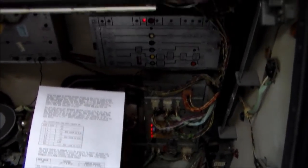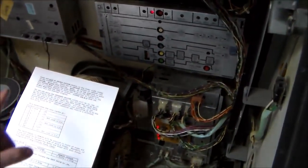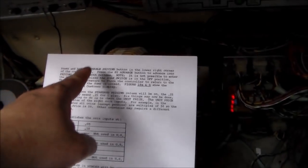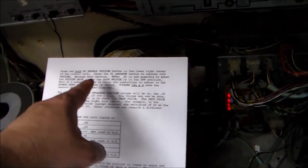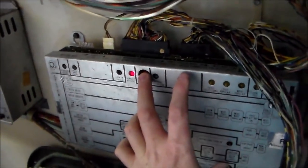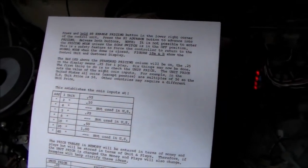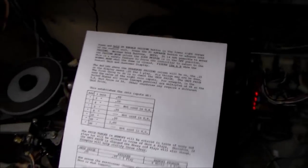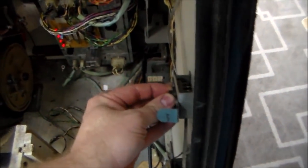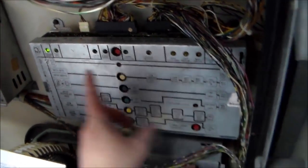With all that said, we're on to the next part of the adventure. It's on default pricing — we need to tell it what price it's supposed to be on. As the manual says: press and hold S8 enable pricing button in the lower right corner, press the S1 advance button to advance into pricing. Watch what happens when I do that — the lights kind of jump and then stop. It's not possible to enter pricing mode unless the scan switch is in the off position. So we put it in off, try it again, and it did it — we're over to standard prices.